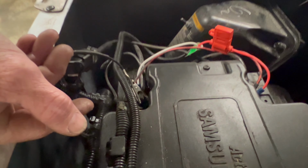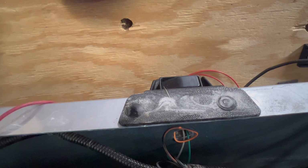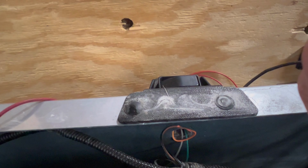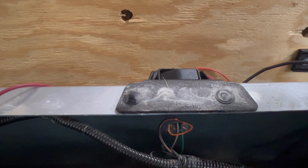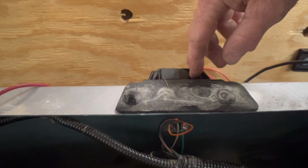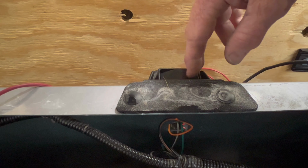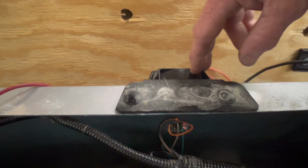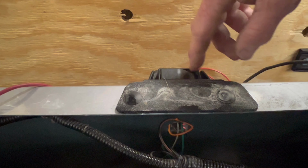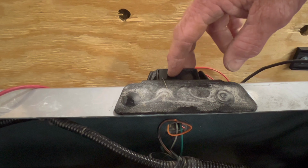But like I said, the next thing you want to do is put it in reverse. All right, that's forward, that's reverse. And this will tell you what's going on, because if you don't have reverse, then a buzzer, like beep. If you don't have that, that tells you that you have no power anywhere. All right, which means you test your charging port and your receptacle. That's the main thing. So here we have no power. If you have power there, go to my page, watch my other videos. So there we don't have power in reverse, and the key's on.